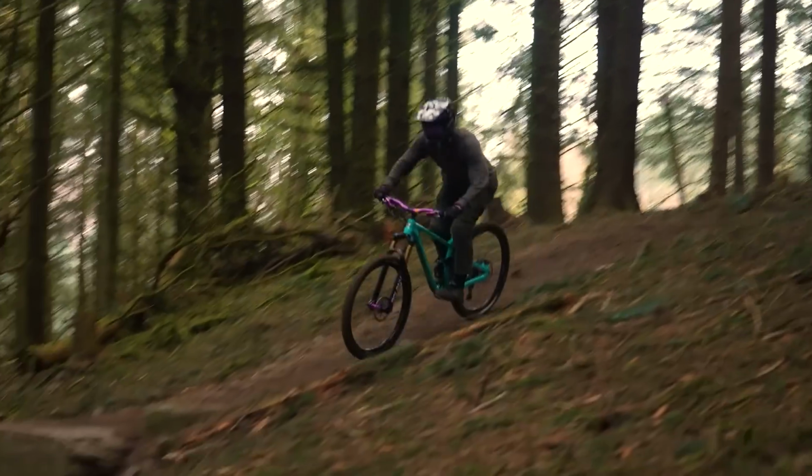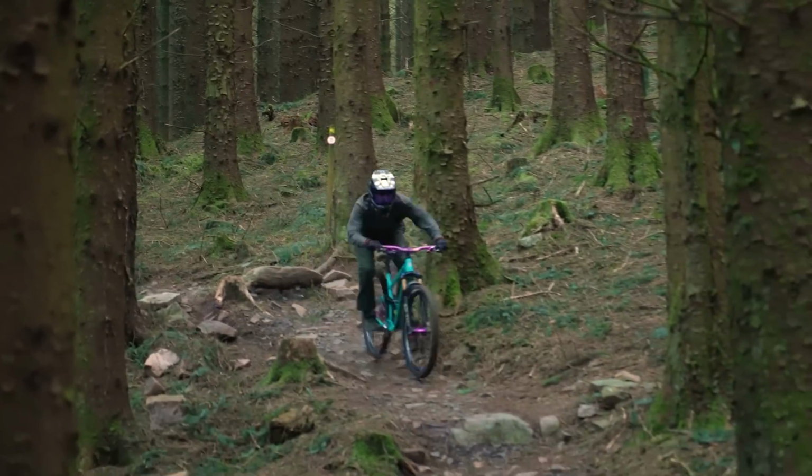And I guess that's the thing. You don't know with a lot of these products how they fare, whereas with brand names, there's that warranty, there's that safety check. In general, the bike has fared fairly well. It's got an issue with the cable on the rear dropper, so we've got to sort that out. Maybe it's the clamp, so I don't think it's unique to this dropper. Also, the piston reservoir cover on one of the brake levers fell off or popped out, which isn't ideal as I just don't think spares are available. And it's not a great thing, really. The part of the brake that you really want to last has just fallen apart, which doesn't really give you a lot of confidence in the rest of it.